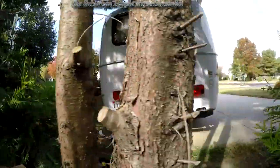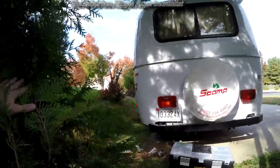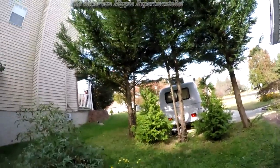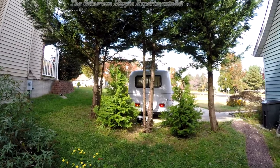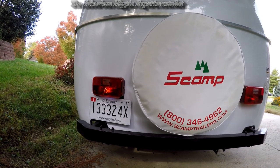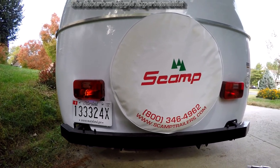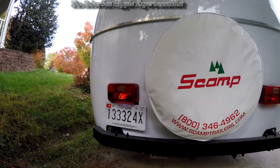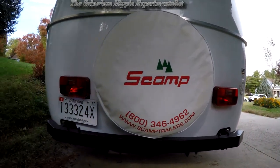The marker lights look better with the reflective tape, but the important thing is the brake lights and turn signals. Looking at the brake lights, they still appear brighter on the incandescent side. LEDs are definitely better for just the running lights, but that's not really what's important — you want people to see when your brake lights are on. So my final conclusion is to leave the incandescents in and take the LEDs out for safety reasons, because the brake lights are brighter on the incandescent side.